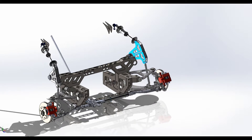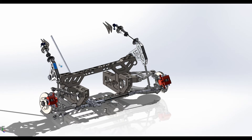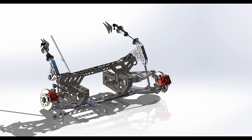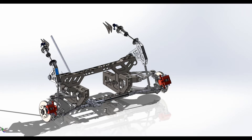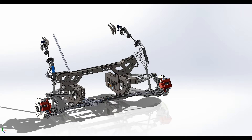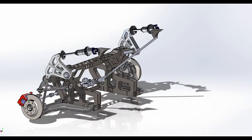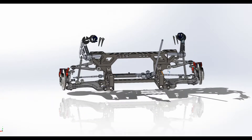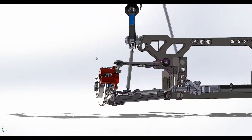This is it running through its motion. There are a couple of reasons that people do this. You can get a progressive spring rate — I might put a link in the description below on someone who explains more about that — and the other reason is it can bring the weight more central, get it away from the wheels. That isn't a huge advantage for me, but I love the way it looks and that's why I've decided to go with this type of suspension.